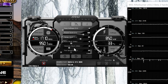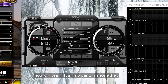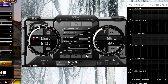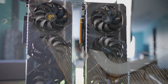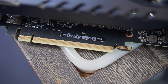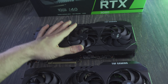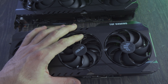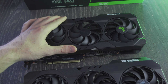If you're currently having this problem and want to fix it, download MSI Afterburner — link in the description below — and apply minus 50 megahertz and a 95% power limit. Do let us know in the comments if it's an OC edition you're having problems with versus a non-OC, which is clocked slightly lower. What we're going to do now is put this retail sample on the test bench and see how much of a difference there is versus the OC edition, and also whether the review sample is a cherry-picked card that overclocks higher than the retail.